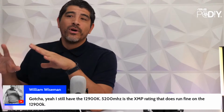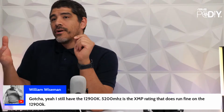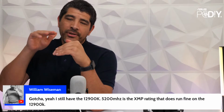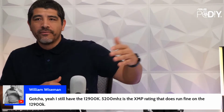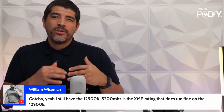And like I said, if you watch the live stream that we have on that, we also give you guidance that if you bought a 6400 kit or a 6600 kit and it wasn't stable, we show you how you can tune down and drop to a slightly lower speed. That would still be an upgrade over what you have, so you can still get a little bit higher performance, but account for the silicon variance in your CPU not being able to run that higher speed. Okay. All right. So let's go with one more question before we go to the next point.